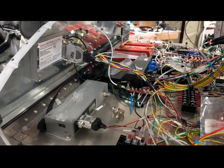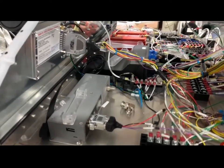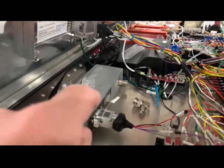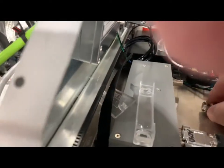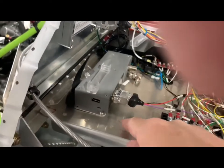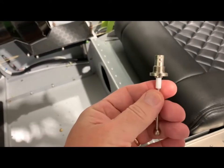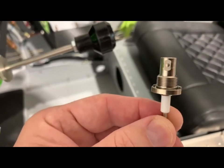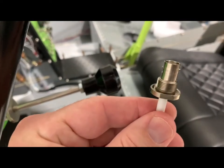It's Saturday morning and family has me booked all day later, so I'm going to try to knock out one antenna. I'm going to antenna my ADS-B receiver, and what it requires is a BNC connection. I went ahead and bought this little 45-degree adapter so my antenna wire can come out underneath and go down the side of the fuselage. The antenna goes underneath the seat sticking up, and as you can see it has those two little nipples sticking out that require a BNC connection.